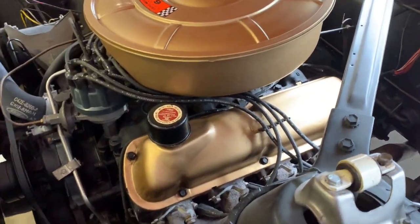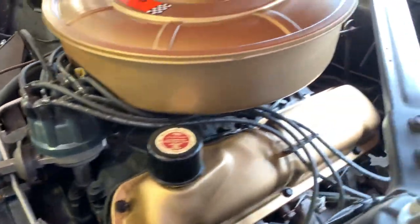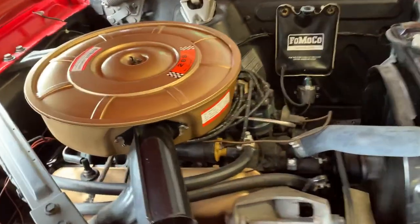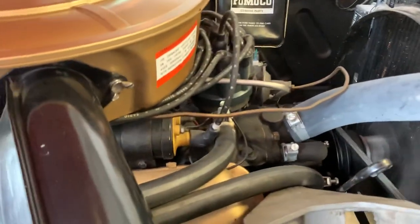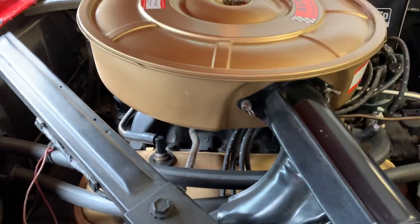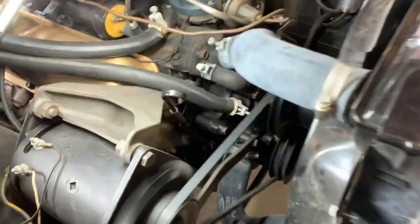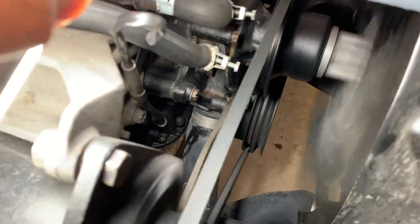Engine has now been running for probably 10 or 12 minutes. Ignition has been addressed. Autolite carburetor looks like it's in pretty good shape — it's a little bit damp at the very top of the carburetor, and I cranked the screws down on the top plate while I was here. I don't think we have anything really leaking or serious. The antifreeze seep is visible right there on the top of the lower radiator hose — it doesn't appear to be coming from the water pump, so it probably just needs the clamp cranked or the hose cut and shortened.